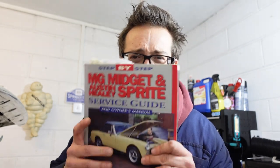The nut is back in the bottom of the sump, the oil filter is filled and on nice and hand-tight. How much oil do we put in? There seems to be a few bits of confusing material about this, but the book says the 1275 oil capacity including the filter is around about 6.5 pints or 3.7 litres. So we're going to put in 3 litres, checking the dipstick as we go. Take the filler cap off and start pouring in some oil.